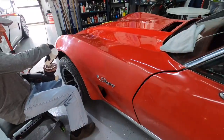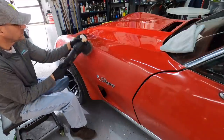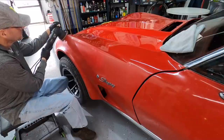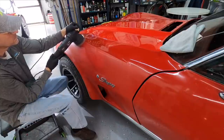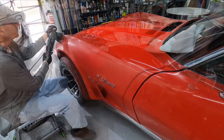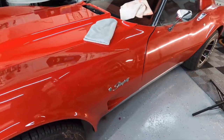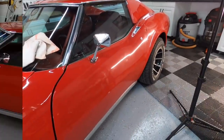Stepping down once again to the LVR-503 Dynamic Cut. With everything polished out, the fender actually turned out better than I thought it would, because it was in rough shape. The little patched-in area is still a little shade off, but the glossier we get it as we throw the protection on in the next step, the more it will sort of blend in and be harder to see. So let's finish out the rest of this car.